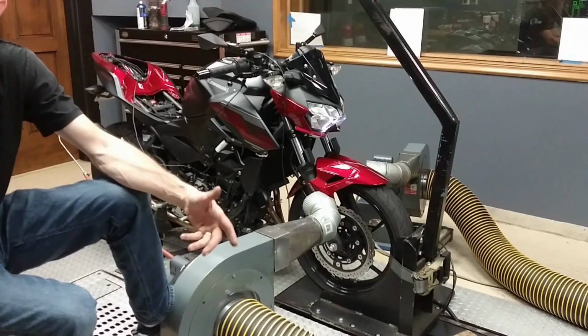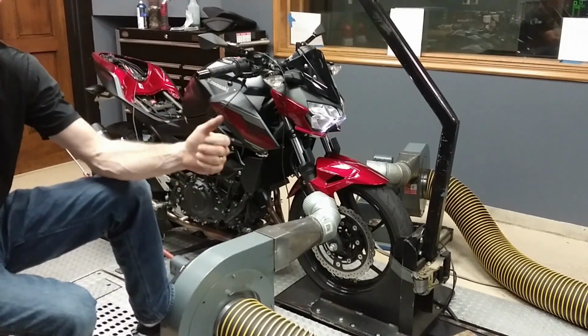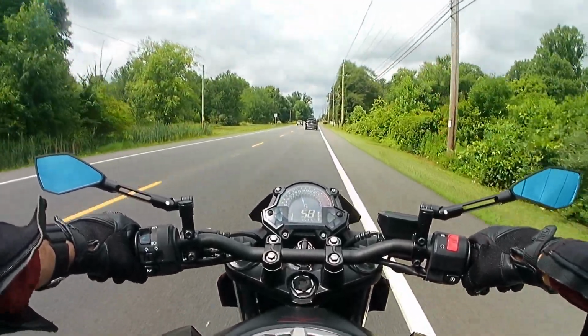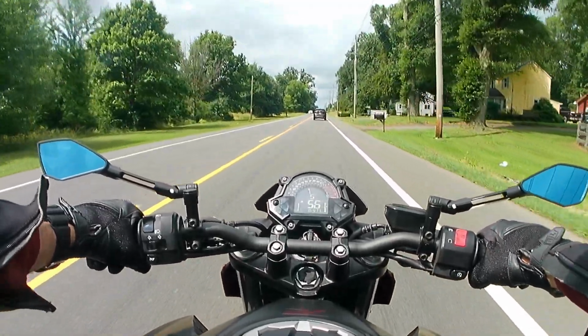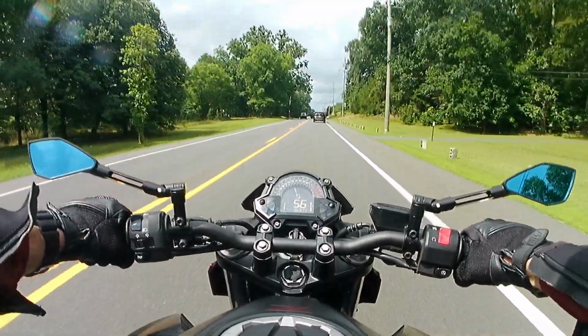In the lower throttle positions, we can't get all the way up to 12,000 RPM because we're just giving it a little gas. We'll probably make it somewhere around 6,000, 7,000. As we increase throttle position, we'll be getting higher and higher into the RPM range. So we're going to go every 500, take readings of all these boxes, and then go back and make the modifications.